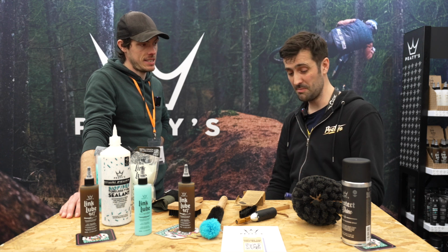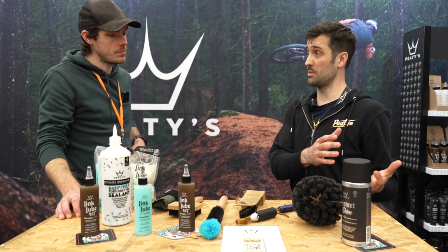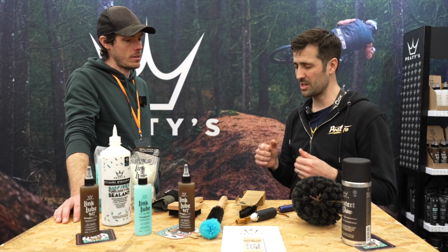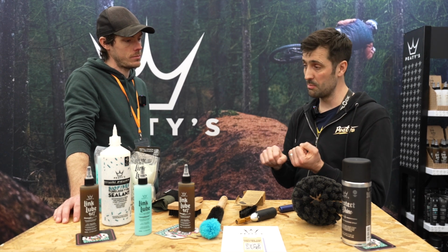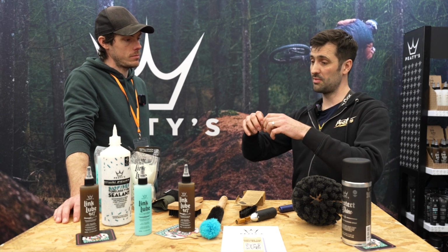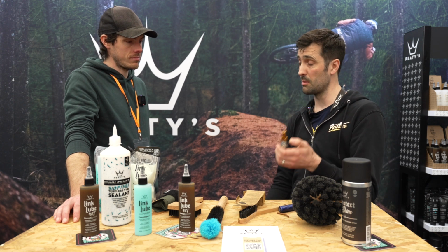So the big problem with tubeless is, probably as you'll know from setting up tubeless to begin with, popping the tyre onto the bead. There are pre-pressurizable canisters that boom them on, but when you're on the trail, you don't have that. With a hand pump, you'd be there forever, you probably wouldn't even be able to do it. If you've ridden for a bit with a flat tyre and the bead's popped off, you won't get it back on again. So CO2 inflators are pretty important.